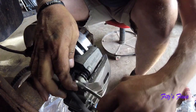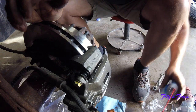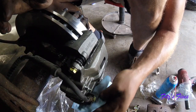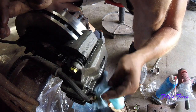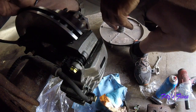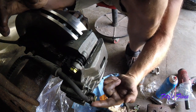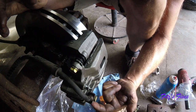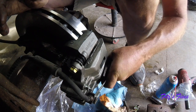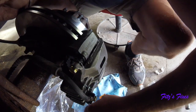This one up here. Spray off this fitting. Get all the oil off of it. Take a rag. Clean up around it. Let it sit for a while. See if you have a leak. Now these are brass crush washers, so you can tighten them up a little bit to get them to seat. So the dry finger come underneath here. No brake fluid, so we're just gonna give one little tighten like that. It's nice and tight. These are nice and tight.